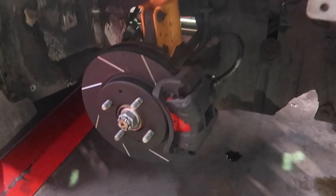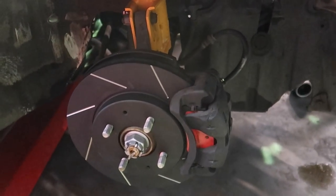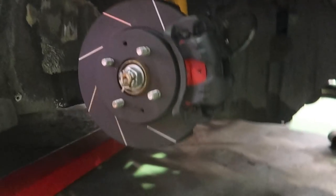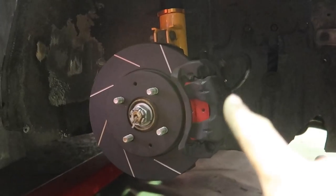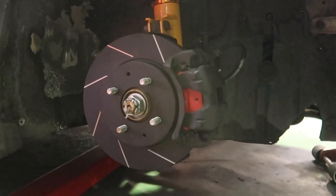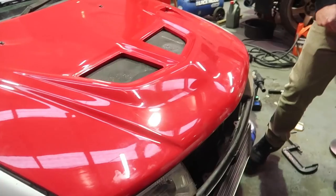Look at that — that is freaking wicked! My first ever full brand new brake rotor and pad install. Very happy — it only took me 15-plus years. Look how good the Brembos look — I don't even have to paint the calipers red because they've already got a little red there. Just had to use a G-clamp to push the piston back and then everything fit super easy — took five minutes. I'll smash out the other side off camera and take it for a drive to bed the brakes in.